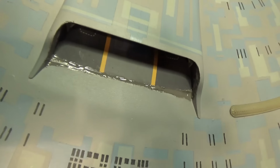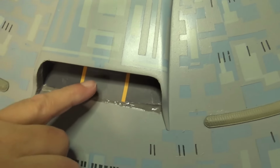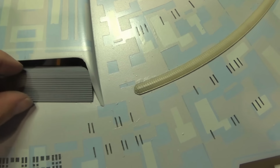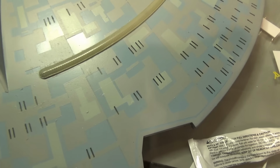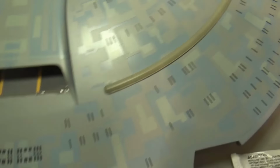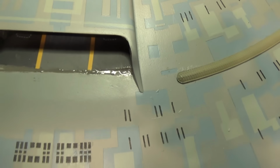Alrighty, I just troweled a little bit of the JB Weld substitute or JB Weld off-brand epoxy into that joint. Yes, it's shiny. That's the nature of it. I'll put a flat coat over that, but frankly, as long as it stays inside the line here, we're in good shape. And it's all inside the line there. We can always touch it up later, but I don't want to get the door glued in here by mistake. Ugh, that's tough to handle. Yeah, that's cleaned up there. And like I said, it's going to find its own level and skin over before it cures, which is why I like using that for this application.